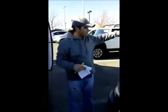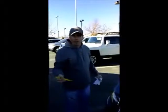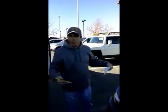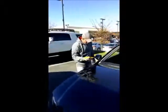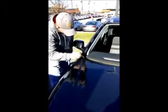Once the glass hits the bead of urethane, there'll be about that much urethane in between the body of the vehicle and the glass, which is perfect. If you run a small bead and the glass is smashed all the way down against the metal, that'll cause stress cracks. Your car goes over a bump, speed bump, pothole, it'll cause the car to shake, and then it could cause a stress crack on your glass. Right now I'm marrying together the seams that I made in the bottom.